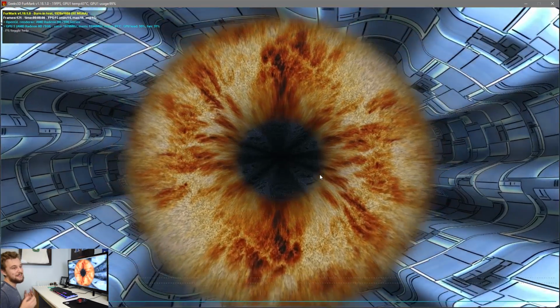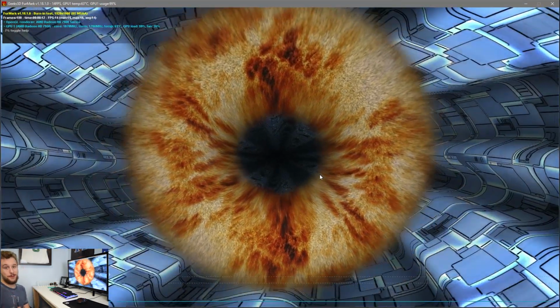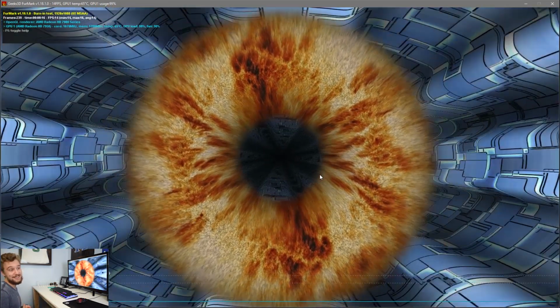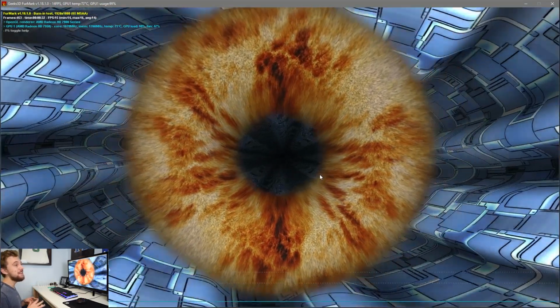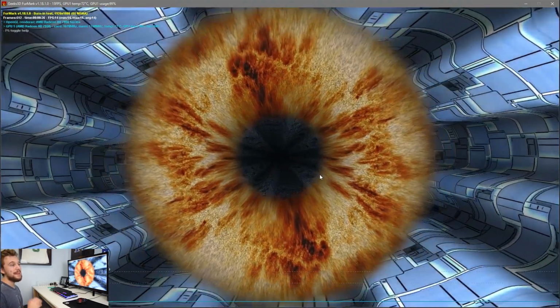So the stress test is going to basically stress the GPU for a short amount of time, recommended 30 minutes at least, so you can actually see if this overclock that you applied is stable. One thing I also want to note is you want to make sure your temperatures aren't outrageous either. 90 degrees Celsius is very hot, and would be the most I would recommend you get on a GPU.